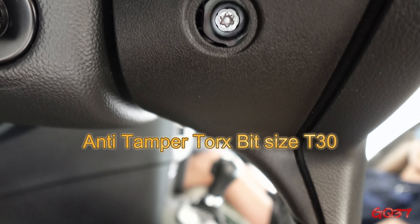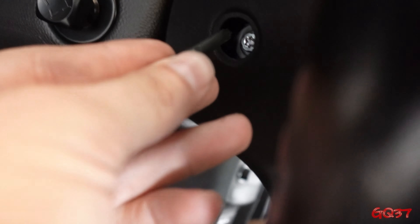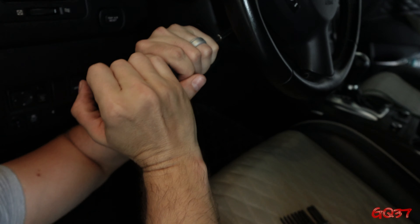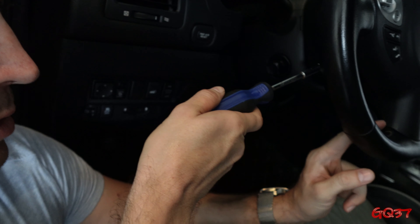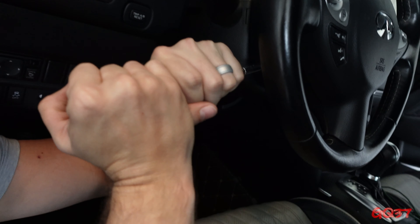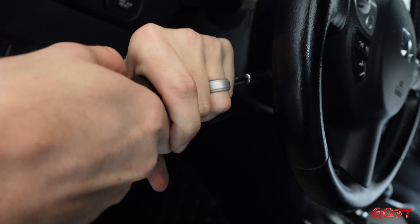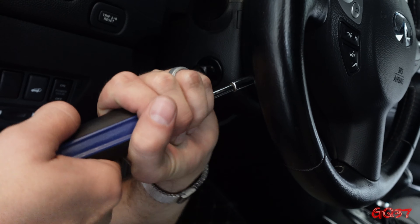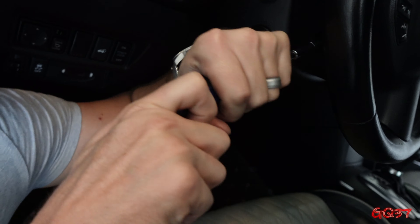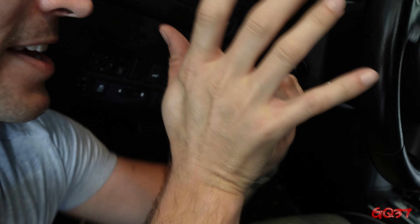This is the hardest part of the process because they're put in with blue Loctite from the factory — they don't want you taking them out. It is a T30 size. You have to be real careful not to strip them. You've got to put a lot of force in; make sure you're pushing in hard on your screwdriver with this bit. A lot of YouTubers make this part look easy and skip over it, but this is the hardest part. Make sure not to break or strip that star head or you're going to have a whole other set of problems. Just take your time and do not use power tools.